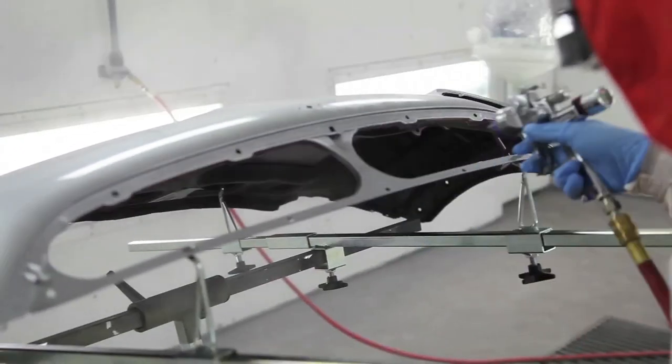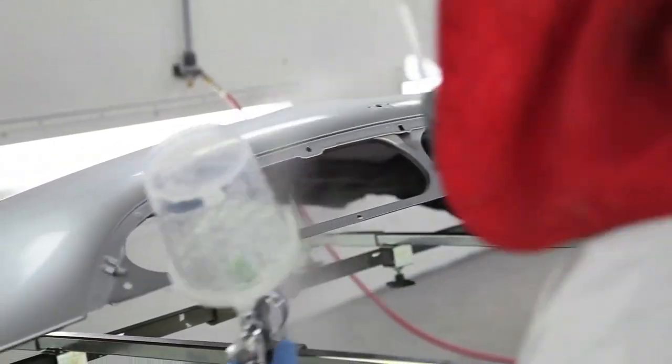If I leave it open and set the wall pressure at 30 instead of exactly 26, I can adjust a little bit. That way, as I'm painting down the side of a car and lose a little pressure, I have room to open it up without closing off that air micrometer.